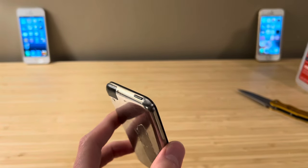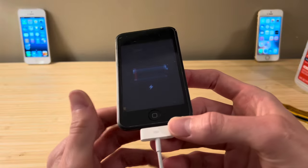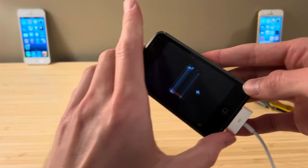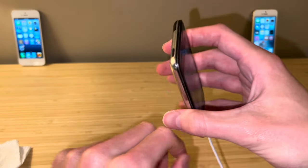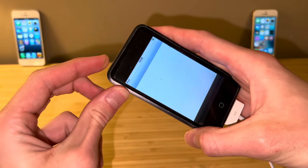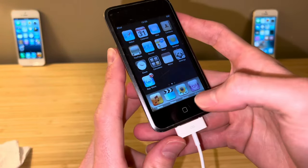I'm going to go ahead and connect this thing to power and see if it turns on. We have the low battery but charging symbol — we'll let this sit for a little bit. Once I get some power we'll see if it boots up. We've got power, but unfortunately we have a bad power button. I did slide to unlock and now I can't close or turn off the iPod. But the home button works, so I guess that's more important anyway.